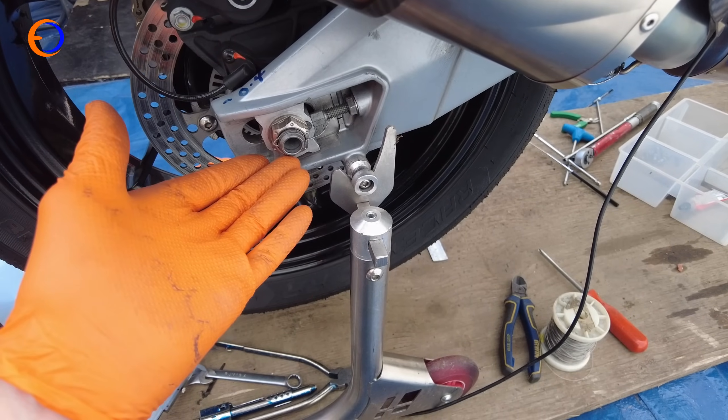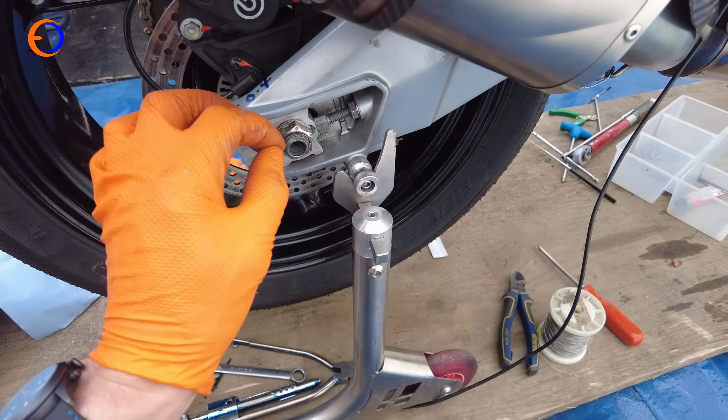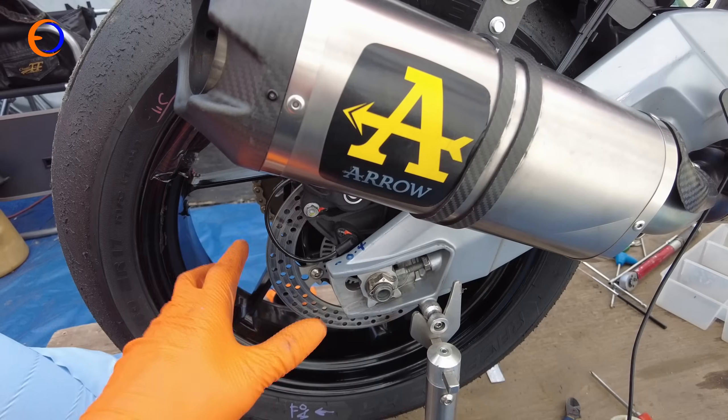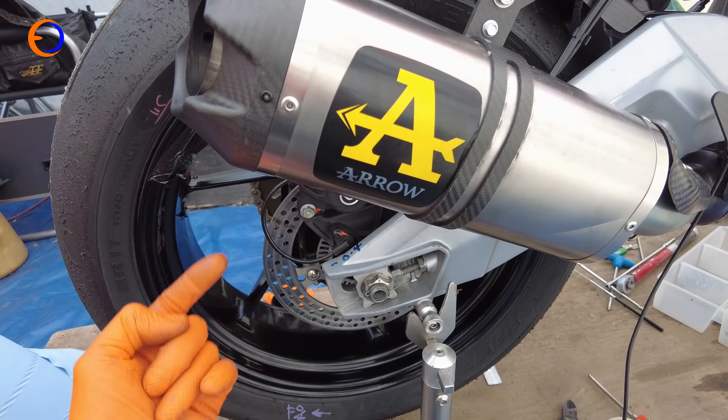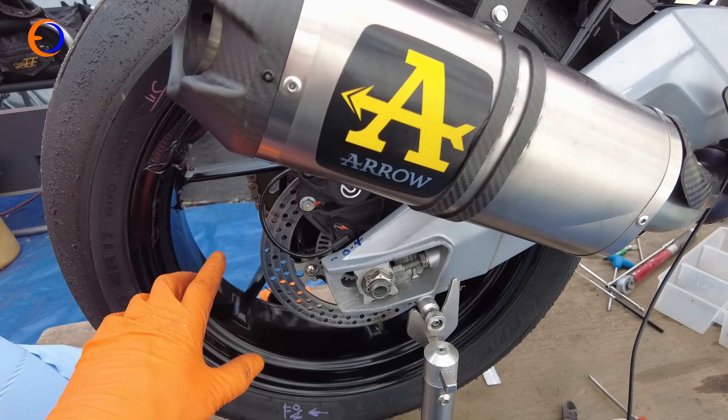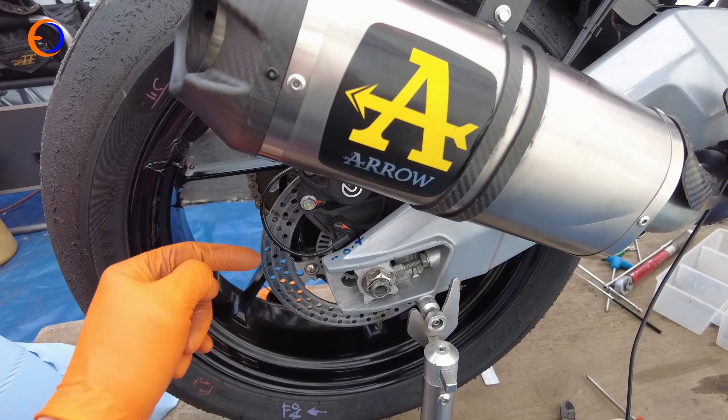It might be a case of cutting the lock wire back off to change the wheels, but it's better to do it now so it definitely can't be forgotten in case there's a warm-up lap. Before I push the bike out I will also put the tyre pressures up a little bit — it's always easier in the holding area to drop a little bit of air out than it is to put cold air in.